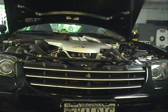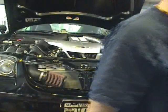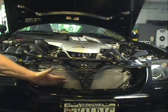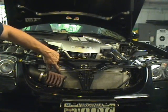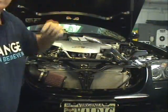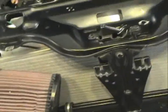This is the final fit-up — get everything on here. Take off the grill and you can see what we got here. Got the whole thing set up. The air cleaner's back in — I turned it at an angle. Some people have been talking about getting water in the air cleaner; well, if it's down at an angle, you've got a whole lot of room for water. I put some window screen across the grill here just to keep bugs off — makes it a lot easier to clean the radiator and doesn't add any real restriction. We've got the spit tank all connected. And if you look real close, we've got some thermal instrumentation here just so we can monitor the water coming out and the water going back in. There's still plenty of room in here for all kinds of stuff we're going to be working on later. Everything's done, and with the grill back on you'd never know it.